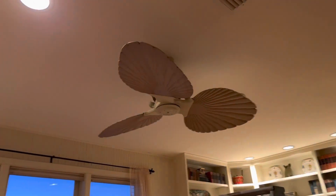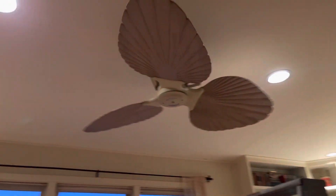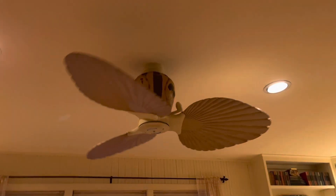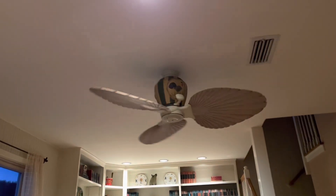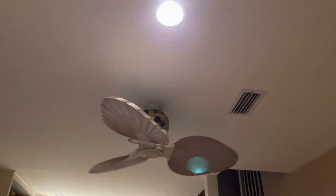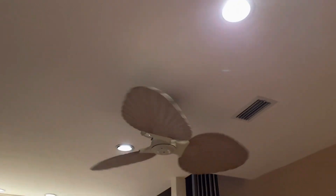As you can see, no more scraping. Unfortunately when this fan had the old flywheel, you couldn't speed it up — you had to turn it on high and then it would work on the lower speeds, but it sometimes still cut out because of that.